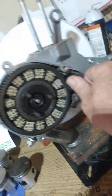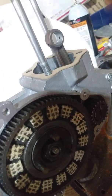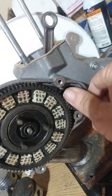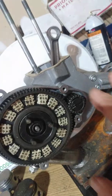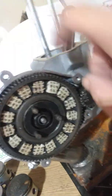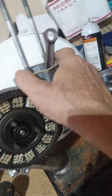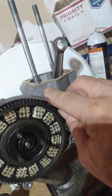I hope this video somehow helps — it's just a little education. I also noticed that little 50cc jobber has two gaskets, small piston, very little crankcase pressure — but that little 50cc probably had a horse and a half on a good day. Any kind of friction on one of these little motors is a horsepower killer. So if you could free up that crank, lose them two gaskets, bring that crankcase pressure up a little bit, put some compression to it, maybe even drop your cylinder and retard the port timing — you might pick up some torque. Just some helpful tips.